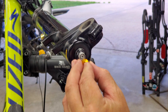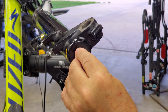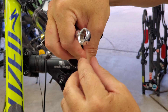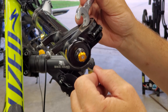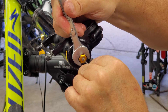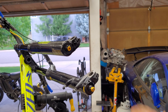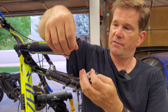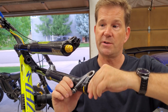Do the same on the other side, then throw the adjustment piece back on. It's keyed, so wiggle it around until you feel it drop into place. Use the 2mm allen to get it started, and a 14mm to hold it in place — I grabbed a 13 by mistake first, but there's the 14mm. Tighten that up, then put the caps on. I'm reusing my old caps so I have a brand new one waiting in reserve. These are already scratched up anyway, so no problem reusing them.